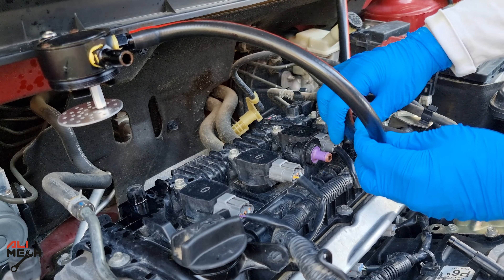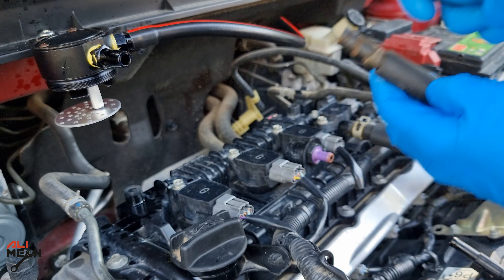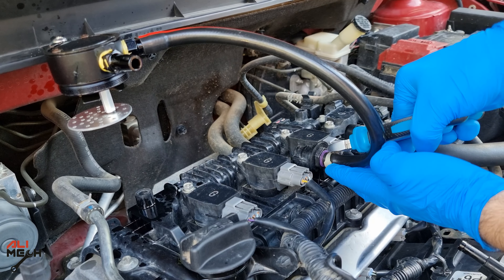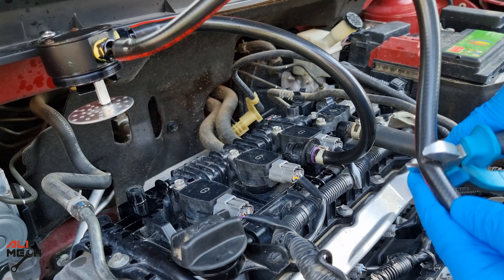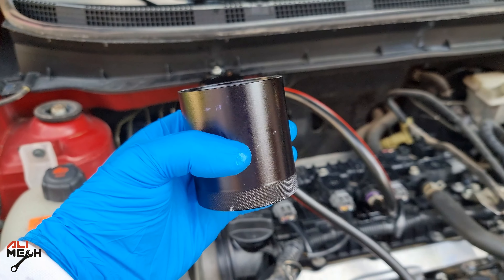Next I will put some WD-40 on the fittings and then insert the hoses. After inserting the hose on the fitting I will mark how much I want and then cut it — just make sure you have a nice smooth curve. I will use the original clamps from the stock hose. You can use a hose clamp for the oil catch can side as well, but because of the fitting and the hose size it was a tight fit, that's why I didn't use it. Here's the last hose — we're gonna cut it and it goes back to the intake manifold.